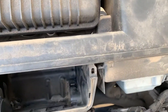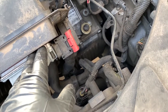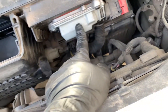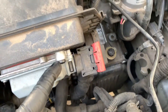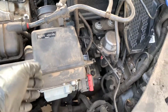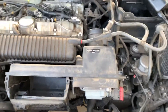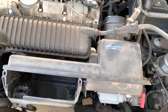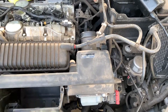I'm in the process of taking the airbox off because there are a couple things I'm trying to do with it. To get the rest of the airbox off, I need to take off — I think these are T40s — the screws holding the ECU to the airbox. Once that's disconnected, the whole thing will pop off and I can get better access to the intake manifold where the injectors are underneath.